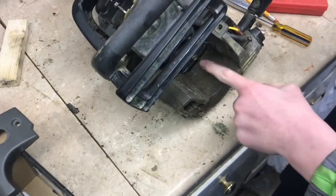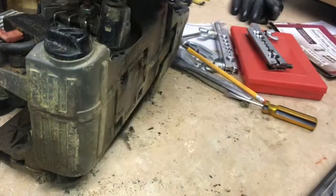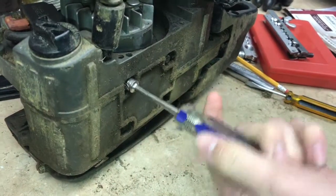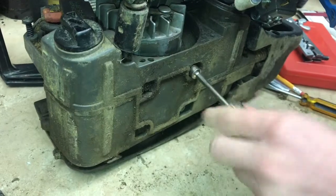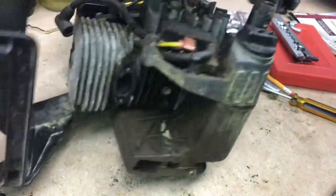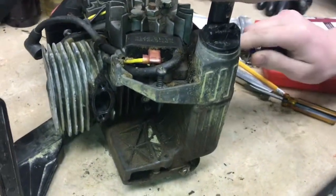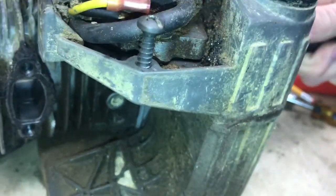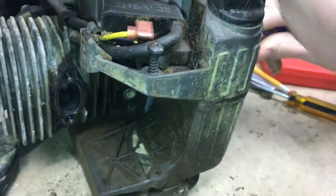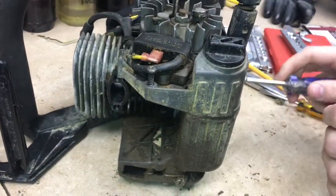Right here, looking in here, there's a gasket. Under here there are bolts, and if we take a screwdriver and put it on there — look at that. See how these bolts just turn? They're barely in there, they're so loose. Whenever I turn them you can even see them start to pull back in. So my guess is that's not airtight and there's unmetered air flowing all around in there. It's important that we tighten these up.